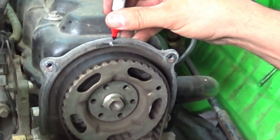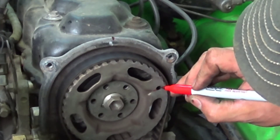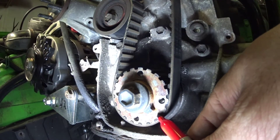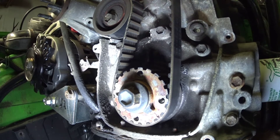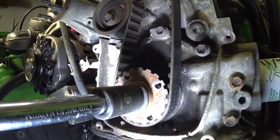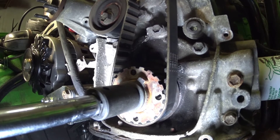I've always been told: before you do anything with timing, you line up your timing marks. So here is a reference — here's your timing mark on your cam gear. And there should be one down on the crank. The crank reference mark is this little dot right there, and it should line up with this line right here. All this stuff is fairly similar whether it's a Chevy small block or whatever — they all have their timing marks that line up. So you just crank it over until all marks line up at the same time.